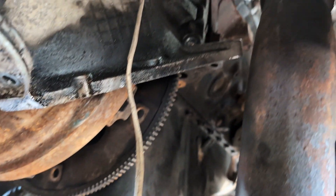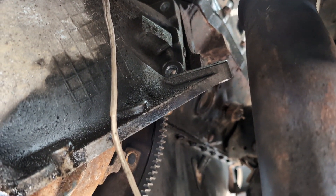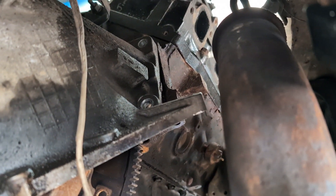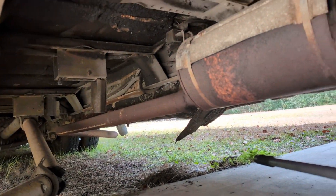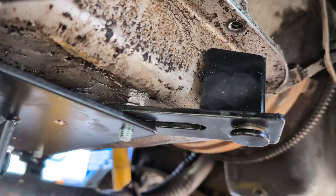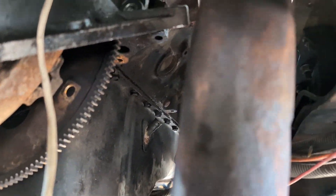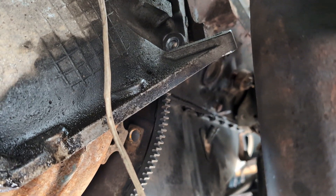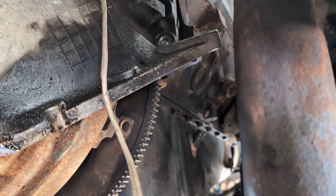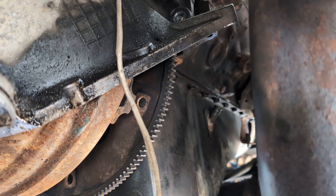Good morning everyone. As you can see, we have some progress — the transmission is now separated from the back of the engine. The alignment pins had gotten stuck, so what we wound up having to do is run a tow strap all the way down the back and give it a little tug with my tractor, and that popped it loose. Now I need to go up front, take care of the power steering pump, finish getting it out of the way, remove an accessory bracket, then go topside and remove the TBI assembly. After that the engine will be ready to be fitted to the crane and lifted.